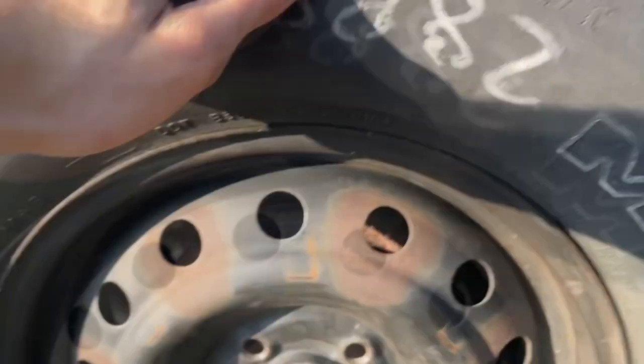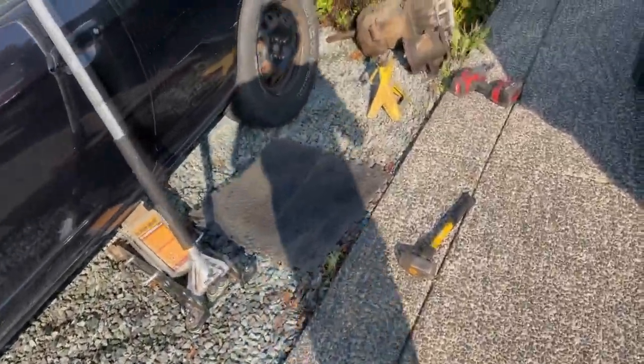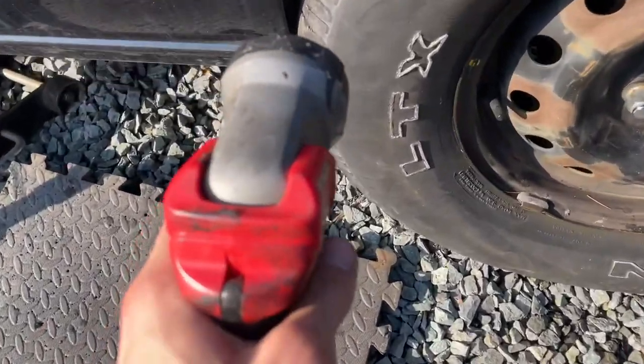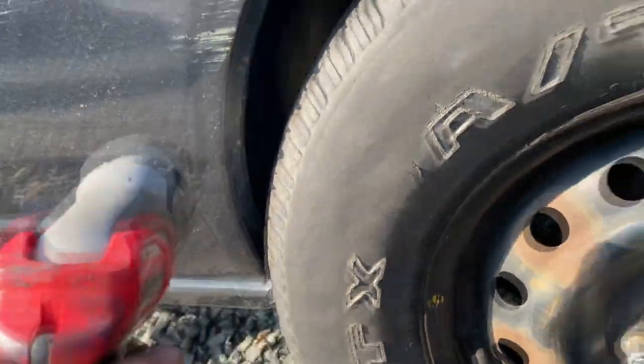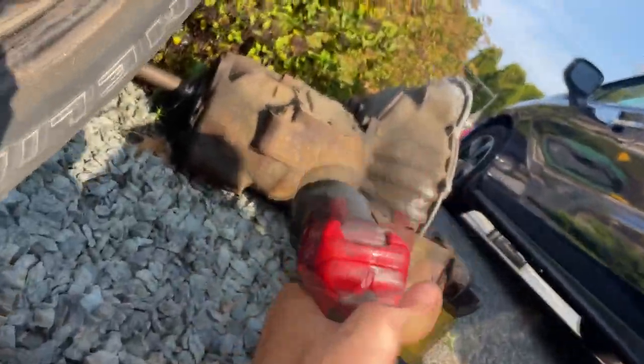This might have hope in the rear — this actually mounts up. All I did was hammer one spot with the sledgehammer and it fits now. Obviously it's super tight up front, but if we cut it to the max we'll have so much room. Look under here — it literally doesn't rub anything! 29s, 75s — look at this, nothing's rubbing. I cannot believe that. You just throw 29s on, dent in this little spot, and you can run them in the rear.